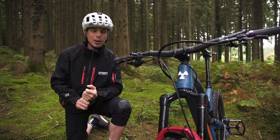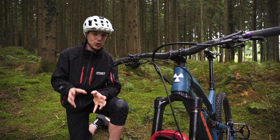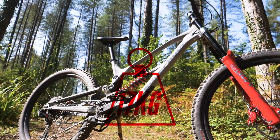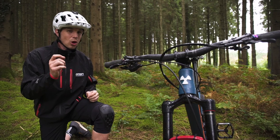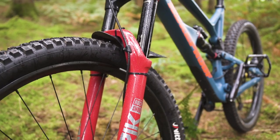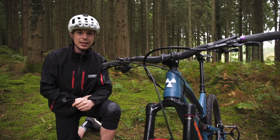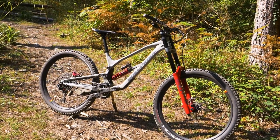So that's gearing and geometry, but what about weight? I would contend that many enduro bikes, at least once raced at a higher level, actually don't come that much shy of that 17 kilo build on the downhill bike. Even with this EWS-winning Nukeproof Mega in this build, although it is a bit lighter, there aren't that many differences. Sure, you go to a single crown fork and this bike does have slightly lighter wheels and tires, but apart from that the builds are actually quite similar. Dare I say it, if you took this bike to Whistler or Finale, you'd probably end up putting a very similar spec to its rowdy cousin over there.